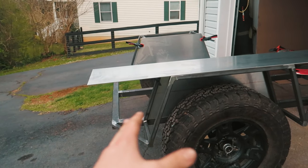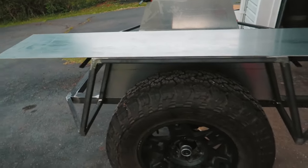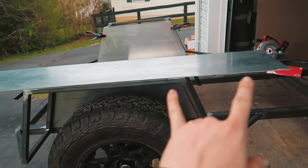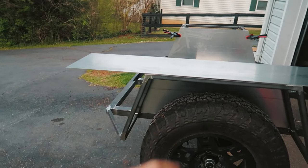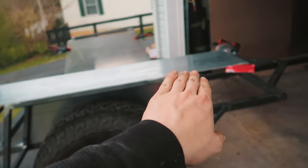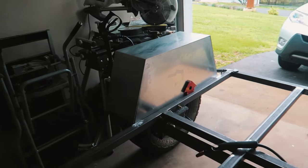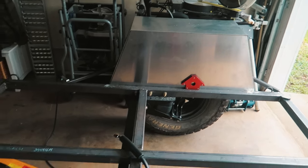These are cut out. This is the top fender liner — I'm going to have to bend these sides down. My next step is figuring out where my bends are going to be. I don't have a sheet metal brake, so I'll mark it, measure, make a line on each side, cut a straight line across, and score a very shallow groove to bend along. I'll clamp it to the fender and use my hand and a rubber mallet to get it bent. The fender skins are all cut and bent — I took a shallow groove on the back side, flipped it over, clamped it, pushed by hand, and it created a crease right where I wanted.